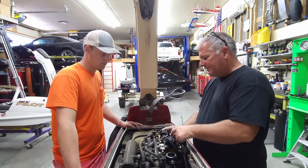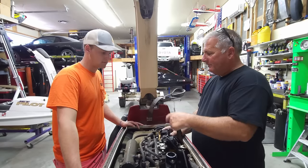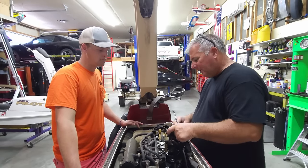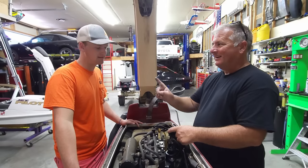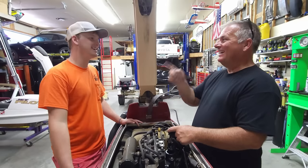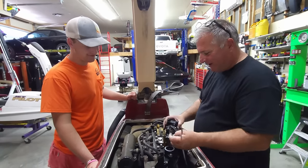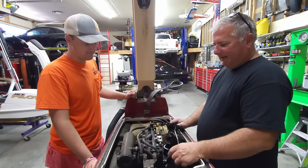We'll look at the carburetor. There's a diaphragm in here that moves back and forth, and if it gets hard, it doesn't move back and forth. It won't pump fuel. So we'll look at all this stuff. If the carburetor works, and it has compression, there's no reason this thing shouldn't run. Well, we got air. We got all the air we want. So we'll assess the fuel and the compression and the spark.